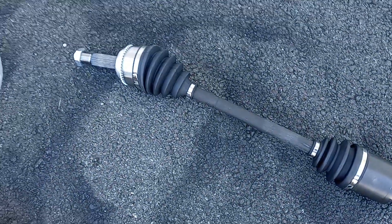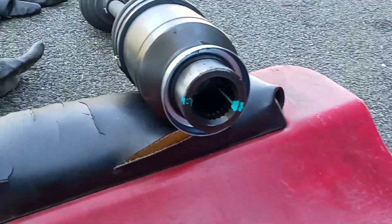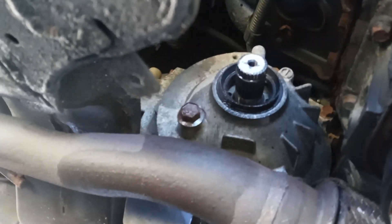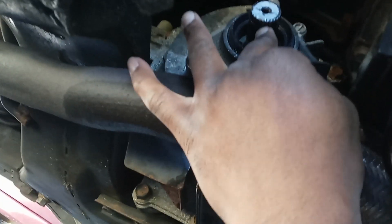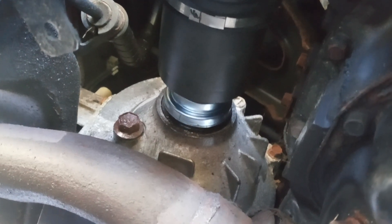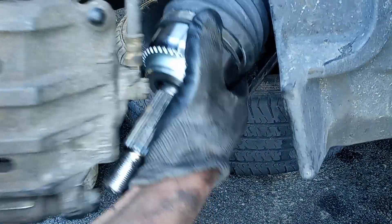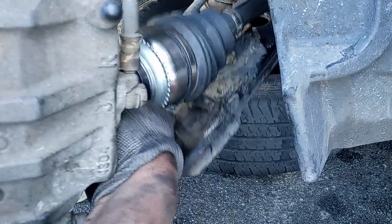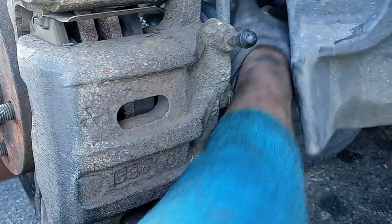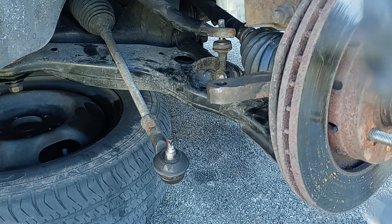Sorry — not a new muffler, excuse me. You'll see the axle. This inner part is going to go inside the transmission. I'll show you — you want to shove it and make sure it locks on the ring right here. You want to rack it, push it in until you hear a click, and that means you're good to go. Try to pull it out — once it holds, you know you're good. The next step is to put this CV axle part inside the spindle.